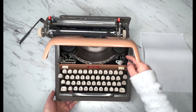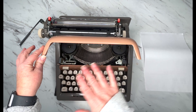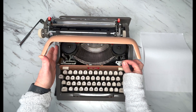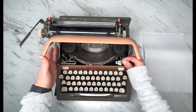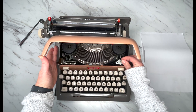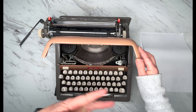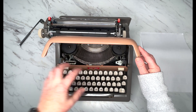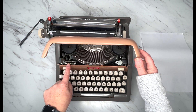Right here on the right side is your color selector. It's on red; stencil is the white — you're never going to use that and it's not going to type properly. If it's ever on white, it's not going to type right. Make sure it's on red or black. Black is in the middle, red is on the bottom, white on the top. Over here is a touch control that determines how hard the type bars strike your paper — it's strictly personal preference based on how hard your fingers strike.